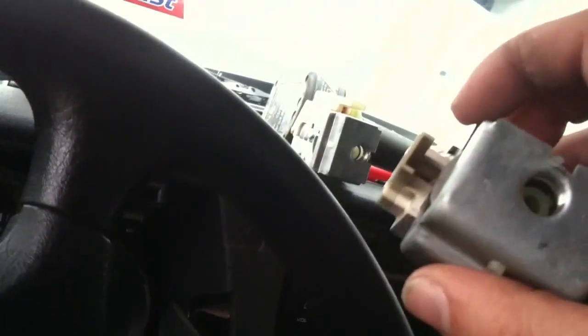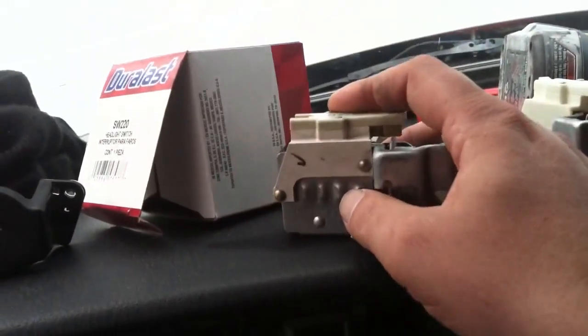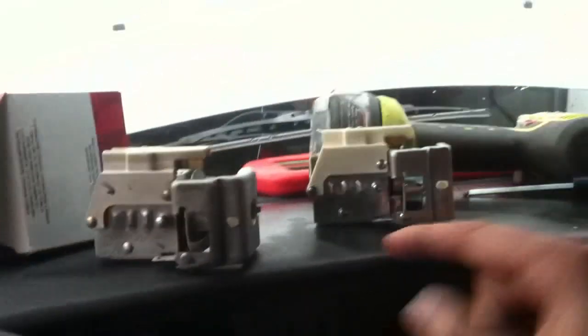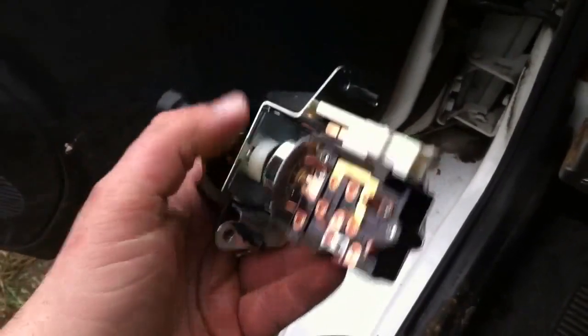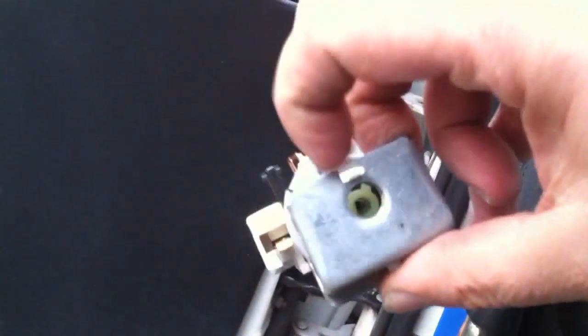On the inside of the old switch you can see a little triangle fitting — it's just worn out on the inside. So we're going to put a brand new one in. To get the knob out there's a little plunger — you push it in while you pull everything out past its little stop, then you stab that into the new switch. With the switch reassembled with the new unit, it turns out there's a little tab inside so that when you reassemble that metal piece onto it, it only goes one way — the tab lines up with a little opening, and that's what ensures correct orientation.